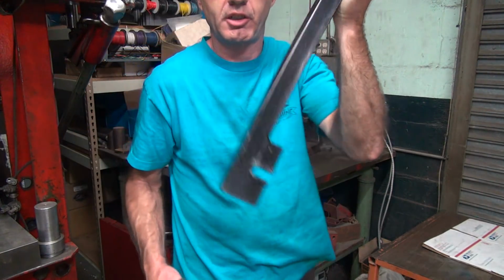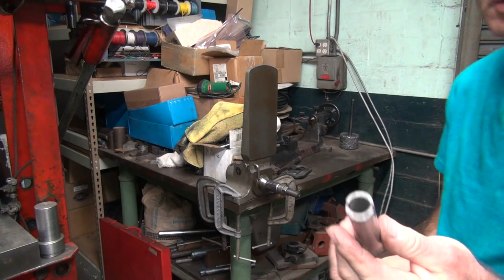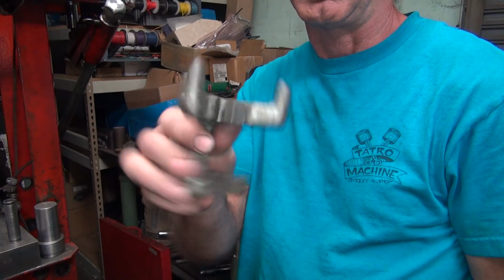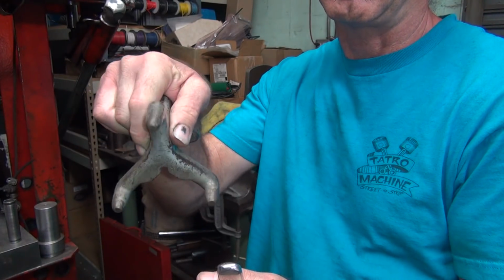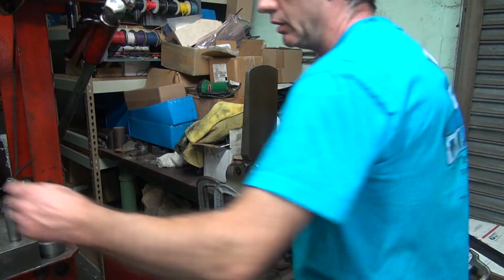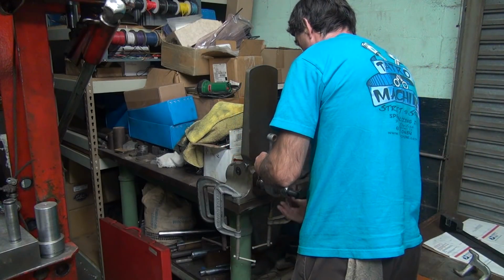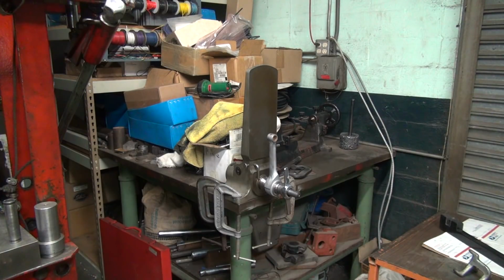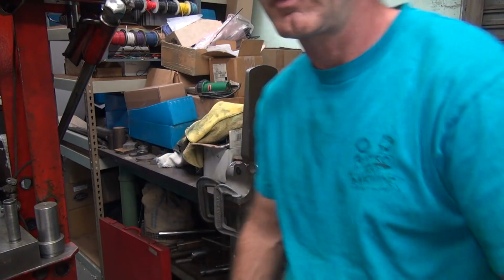So we have a rod straightening tool, a good wrist pin, a long one, the tightening tool, and the dog. The dog goes on the wrist pin here, and these three surfaces here check the tilt of the rod, so you know it's straight. You check them one at a time. It helps to have light on. You can't see nearly as well in the dark.